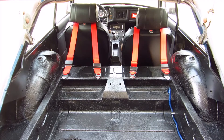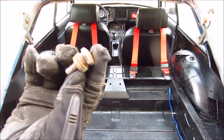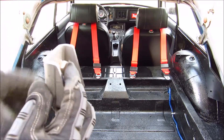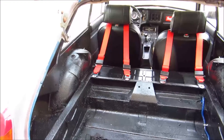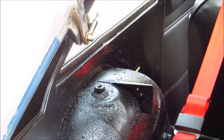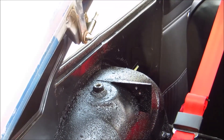If you get your stock harnesses, you're going to find this bolt or your stock seatbelt position over there. Get the bolt and washer that was in there because the threads aren't very deep — they only go in about this much. Put it in here, and then what you want to do is put this bracket on and screw it down on that side so you can mock up your bar and then cut it however you want.